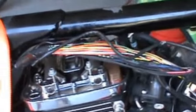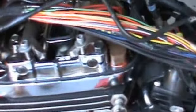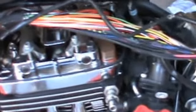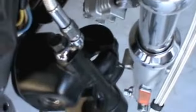The saving grace is it snapped where there's still some stud sticking out, so I think I can get pliers on it and carefully work it out — though the Loctite will make it difficult. The other option is to leave it, since most of the thread is still inside. I'm pretty confident I could leave it with no issues; worst case it might start to leak a little. Part of me says leave it and get the rocker box tops powder coated black. Part of me says change it for peace of mind. But honestly I really don't feel like diving back into it. I'm confident about everything else, including the wire splicing.